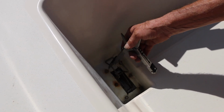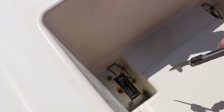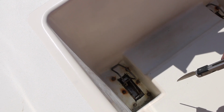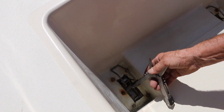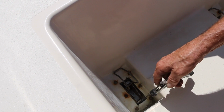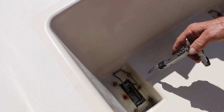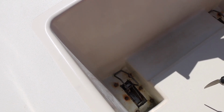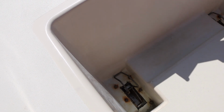Replace these screws with new ones: diameter 10, 24 threads per inch, 1.5 inches long, using nylock nuts and washers. Be sure to push sealant into the holes that the screws are about to go into to seal that seam too. When it's all screwed back in place, reinstall the baler body and you're all set to go.